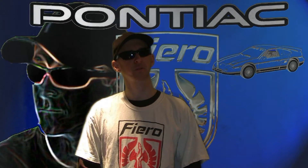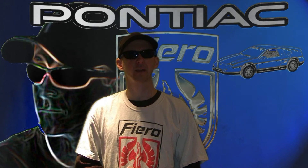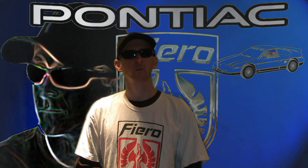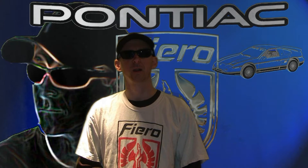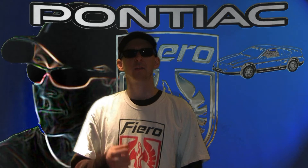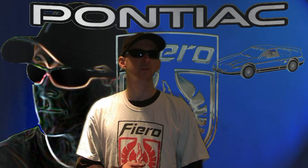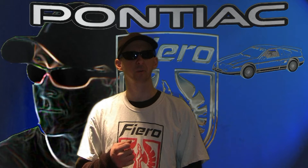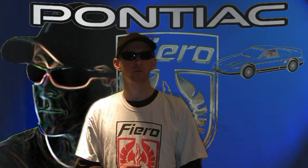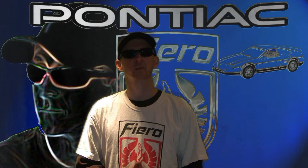Hi, thanks for checking out this how-to Fiero video. In this video I'm converting the rear struts found on the 84 to 87 Fieros and converting them to coilovers. Some coilover write-ups I've seen online require cutting the perch off the strut, but I'm going to try out a kit sold by a company called Ground Control in which you do not cut the perch. They have a kit specifically for the Fiero and I'm anxious to try it out. I chose to go with a 350 lb spring with my kit for a firmer ride because I intend on doing a bit of racing with my car, but you can use whatever spring rate you wish, or you can ask them for their opinion as to what you should use.